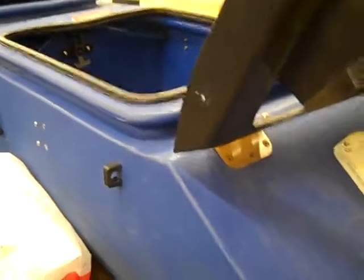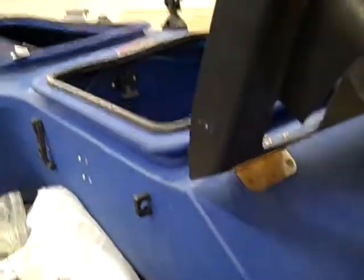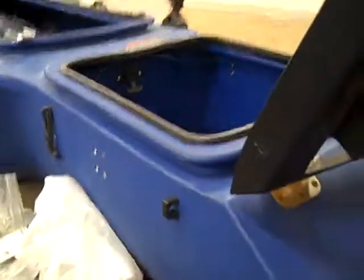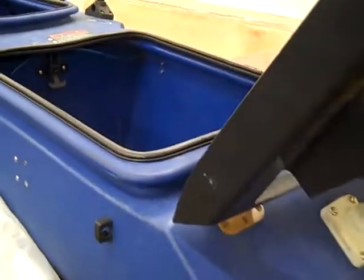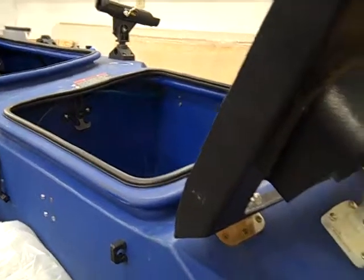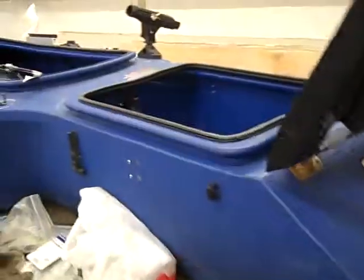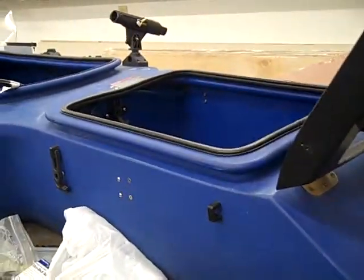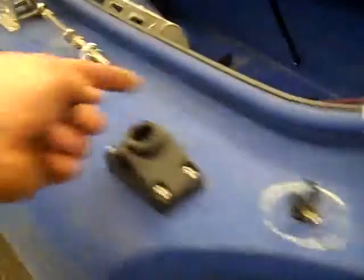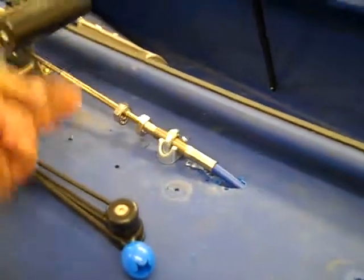One thing to keep in mind: I'm going to be a cable short on this machine because the motor I bought — the carburetor doesn't run a choke. So I don't have a choke cable, and I'm hoping that's not going to be an issue running that racing carburetor. I may end up switching back to one of those big Honda-style two-barrel carburetors to make this motor run. Since it's been dynoed and stuff, I imagine it just fires right up and runs, but that's probably at 70 degrees — who knows what's going to happen when it's 30 degrees out. If that's the case, I'm going to use the stock manual cable and just bring it up inside here vertically.